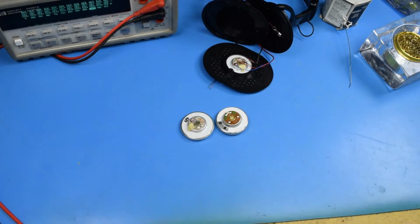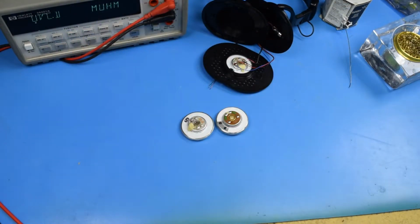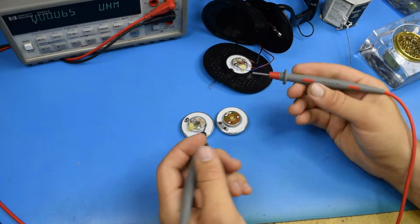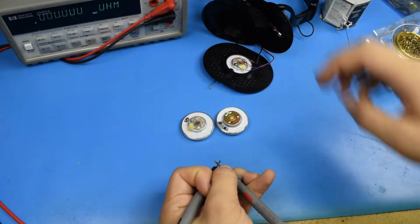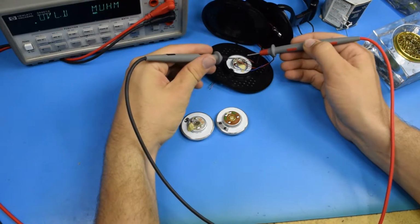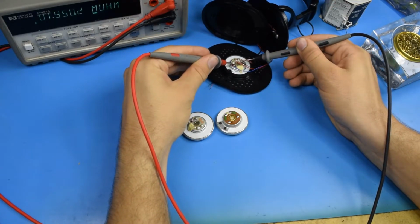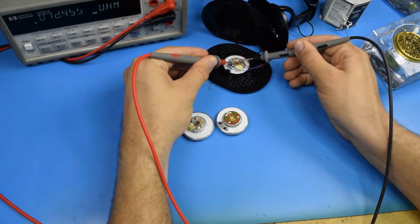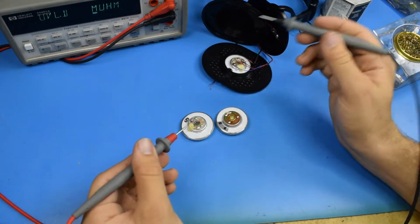We're going to use our 34401 here, and we're going to measure the ohms. So, let's go ahead. Yep, 0. Alright. And we can actually do this null out. Bam. So, good headphones, we can measure these. Driver should have a specific resistance, okay? That looks about right, 73 ohms. Measure the ones we have over here, though.